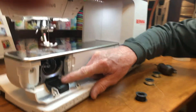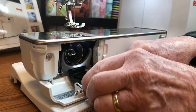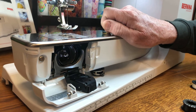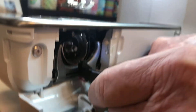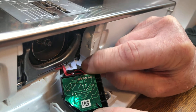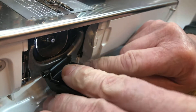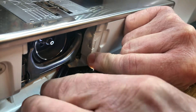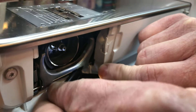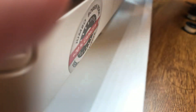Here's another thing — what the machine looks for when checking the bobbin is this little black unit called a bobbin monitor. This bobbin monitor snaps into the door. I had a customer call me after watching my video saying her bobbin thing just popped out, so I walked her through putting it back in. There's a red series of wires back here that plugs in — make sure that's plugged in and the light is on. To seat it right, put one side in first, then do the center on the other side, then pull out on the left part and snap it in so it all stays together and closes up.